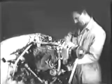When you've removed all the cylinders and pistons and covered up all the open ports, you can move to a workbench where it's easier to make your inspection and repairs. Your overhaul job will be a whole lot easier if you're systematic about it. Line up the cylinders and pistons so you can work on them in order. Notice that all the parts are tagged, so there'll be no question where they go when you reinstall them. Now you can go to work on the cylinders.